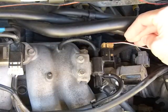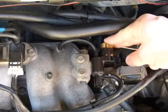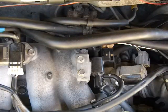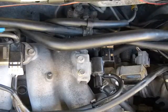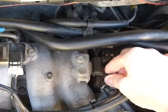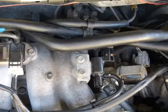I do know that the engine code I deleted with the code reader did not come back after a month. So this is what I would call a jiggle-and-clean operation. It doesn't quite conform to what was written in the service manual, but that service manual was for the Protege 5 and this is just the Protege, same year. No more engine light, no more trouble code, and the solenoid works. It just needed good electrical contact — clean it up a little bit. If the old connection has just one grit of dirt and sucks a little false air, it can give you a trouble code. Could be any one of those — jiggle and clean.